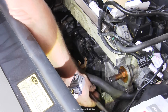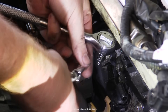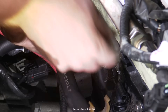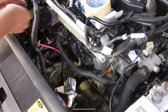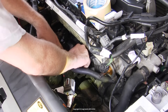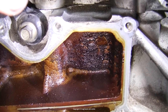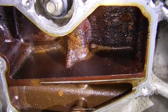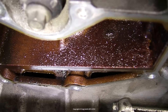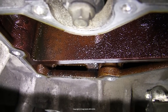You need to undo all of the bolts holding the oil separator on — not at all difficult, except for one or two that are behind the hose, where you really want a quarter-inch universal socket, although a small spanner would probably work too. With the bolts out, the separator will just come away. Now you can see inside the engine and check the cast alloy part of the oil-air separator for sludge, which is what you'd be most concerned about. A build-up of sludge would indicate a serious problem with the engine, but this looks pretty clean, so no problems.